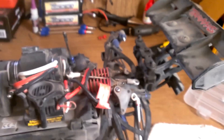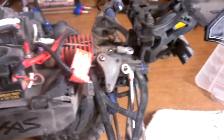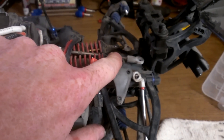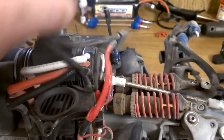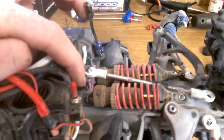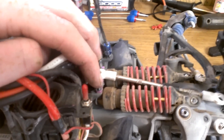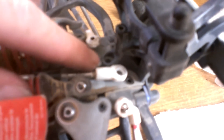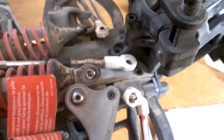To get started, you're going to need to remove the screw from the top of the shock and from the link here. Then there are two screws here — there are battery wires in the way, you don't need to take those all the way out, just up enough. Then there are three back here: one here, one over here, and one right here. Remove those. Then there are two on the bottom there.